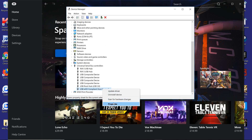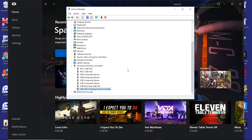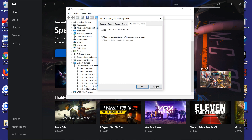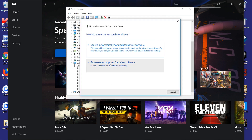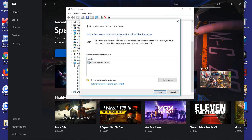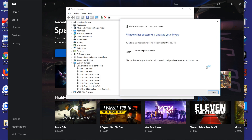The next thing to check is power management. For some reason, 'Allow the computer to turn off this device to save power' is turned on. If it's checked, click it and uncheck it. Do this for each USB device — right-click, properties, power management, check each one individually. Some you won't be able to anyway. The same goes for the USB composite devices — just click through and let it install.